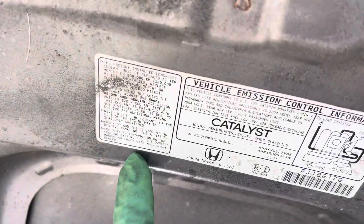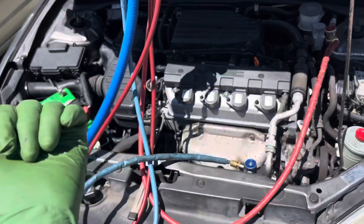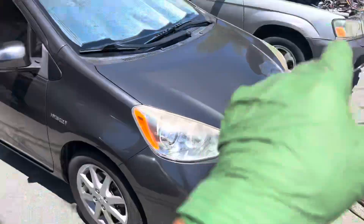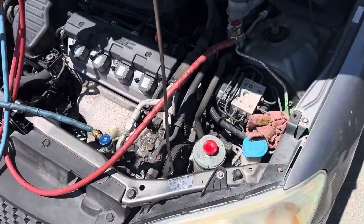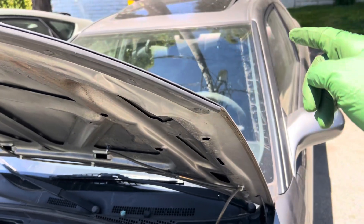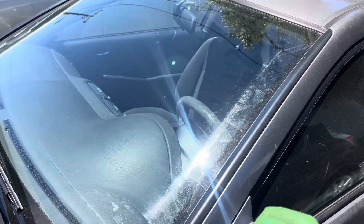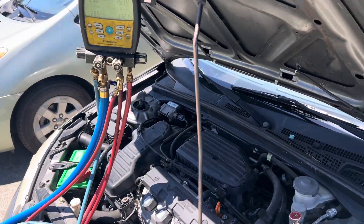We are back out on this 2004 Civic with 550 grams of R134 refrigerant. In other videos I mentioned what I found wrong about the slow leaks at the receiver. This is the mechanic's car — he came to me while I was working on the Forester. I made time for him because it would make good video. How low the pressure was — it was 130-something psi, even though I was trying to load it up. It's only 79 degrees out here but over 100 inside the car, and my high side was only 134 psi. Damn, that's low.